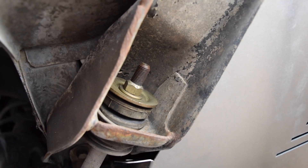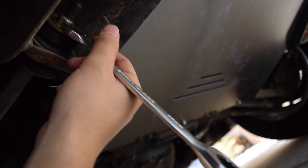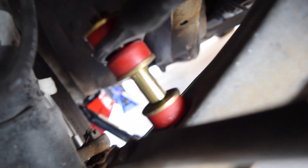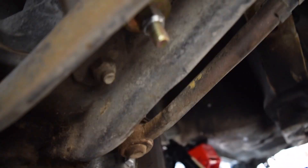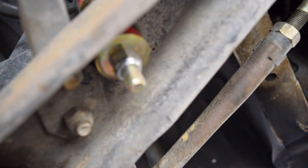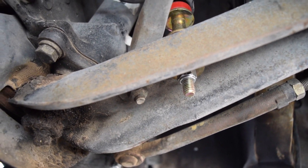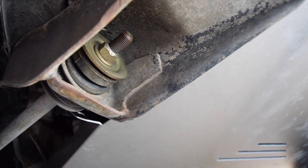What we want to do is put some WD-40 on this bolt because this one gets stuck pretty easily, and because we can't get an impact wrench in here we're going to have to use a 17-millimeter wrench and just break it loose. There are two more bolts that hold on to the bottom — right on top there, next to the sway bar link — so we're going to put some WD-40 on those as well. Luckily we can get our impact wrench on those, so it won't be too difficult.